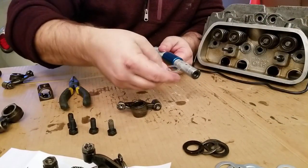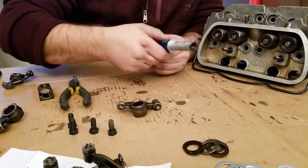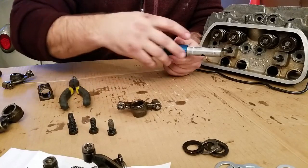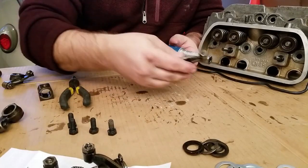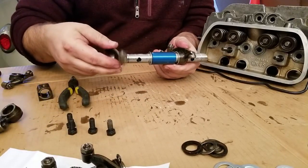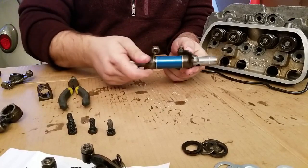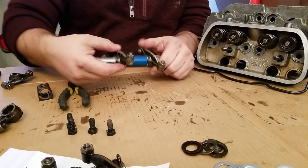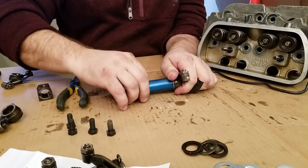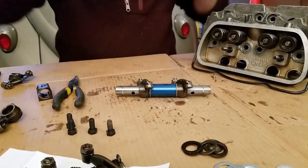So grab a couple of those thin washers again. Alright. Now these washers do have a flat and a beveled side. I put the flat side out to meet the actual rocker arms. So there's the first two. This will just give us an idea of how off we're going to be when it comes to assembling this. I'm not sure. Those little oil passages in there are interesting. It's a nice way of saying it'd be a pain in the butt.